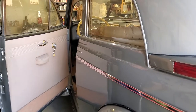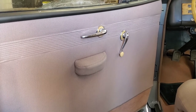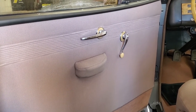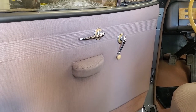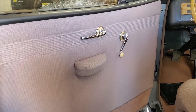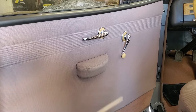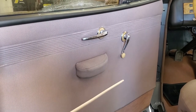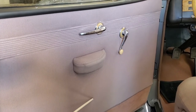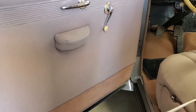When we open the door of the car, we can show you a number of the materials right here on this particular door panel. Your main cloth in the 30s and 40s will most likely be a Bedford cord or a broadcloth. It could still be mohair, and sometimes it's going to be leather. Those four materials would be used on things such as the armrest, the door panel itself, as well as the seats in the automobile.